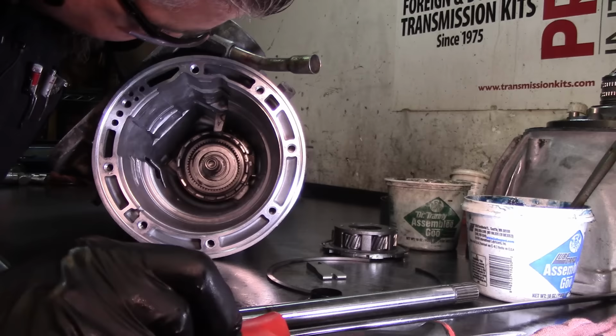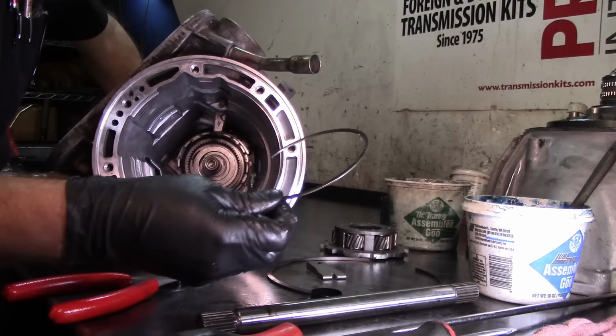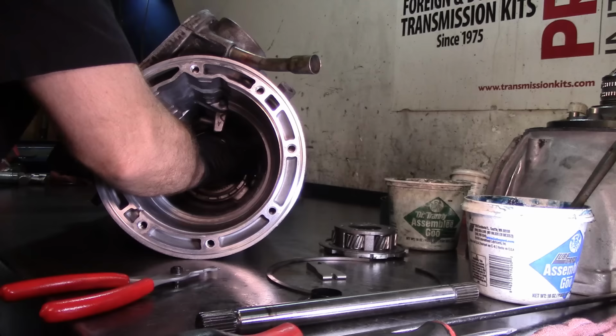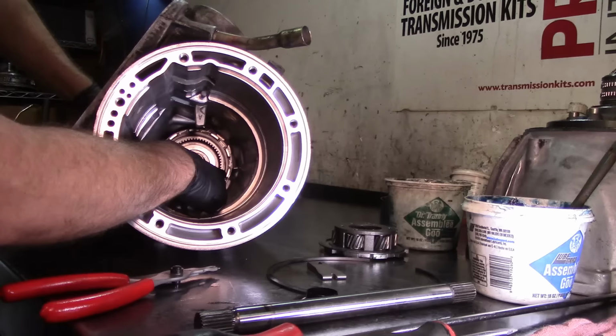Now I'm gonna get the reverse drum, rotate clockwise and pull all the way to the front. I want to pull it all the way to the front because I want my snap ring groove for the rear planetary gear to go into the groove. So I'm gonna turn clockwise and pull all the way to the front. Sometimes it's a little bit difficult, but do it as hard as you can, or loosen up your bolts over here. If you can't, rotate it just enough that the band loosens up itself and you can rotate clockwise